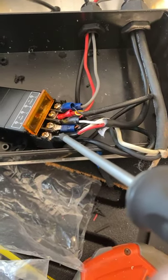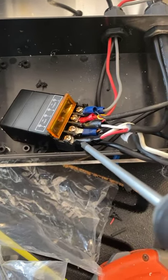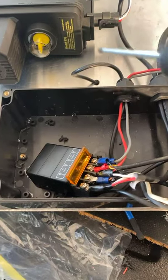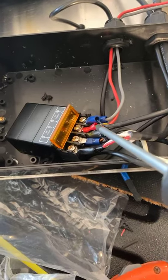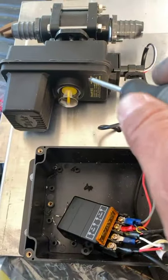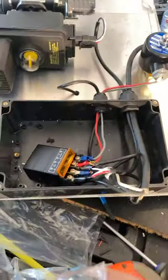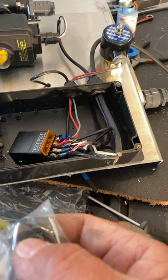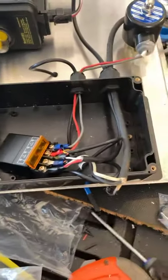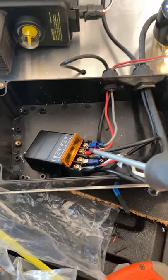So you've got your power coming in. Your 12-volt shutoff valve hot wire goes to that first screw from the left. Your negative wire coming from your battery — tied in with your 12-volt — goes to your second screw. Now the last two screws is your power going out. In order for this valve to work, to come on and off, you've got to have that white wire on the third — this is what opens and closes it. That white wire tells it to open and close. Then your strobe and your solenoid hook to the last two screws on your control panel.